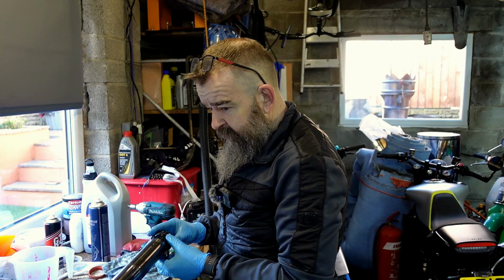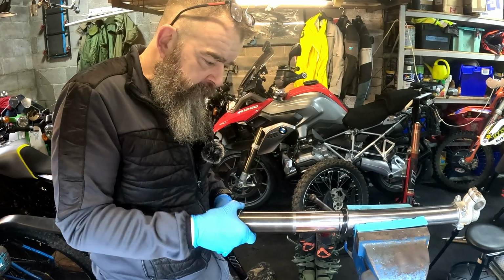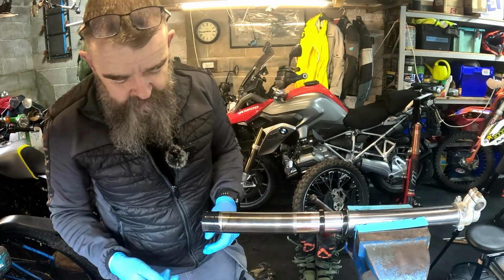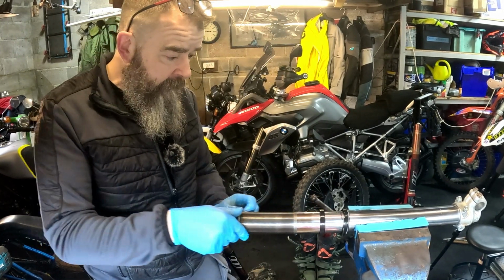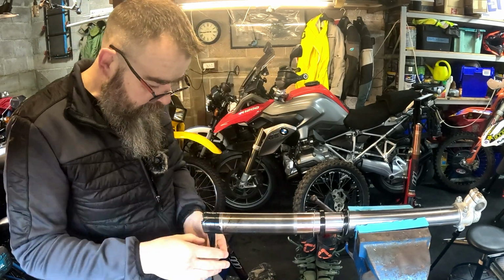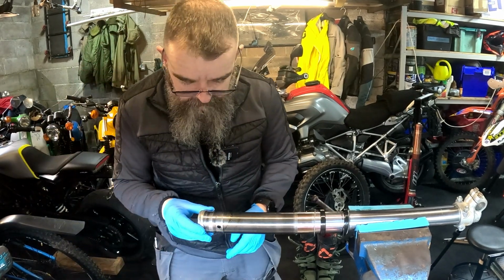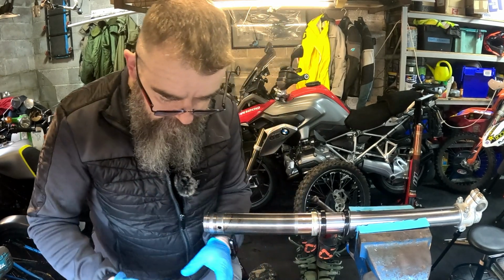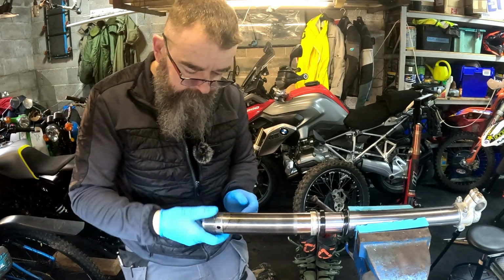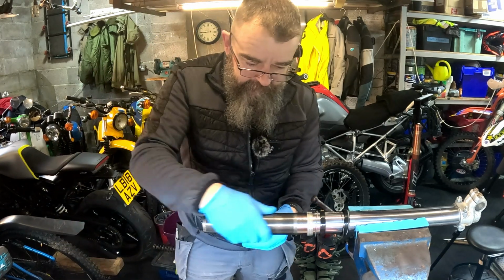and then your main seal, because you're sort of working backwards here, aren't you? There we go. As I say, as you go on, just slide them on and turn it at the same time. Base washer, stick that in, don't forget him. And then we're all done now with the tape. Take your tape off. Top bushing, that really needs changing, so we're going to have to get that changed. Just get a bit of oil underneath it. Just make sure everything's sort of lubed.